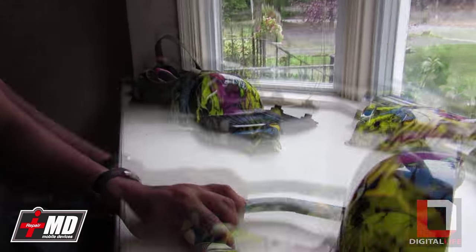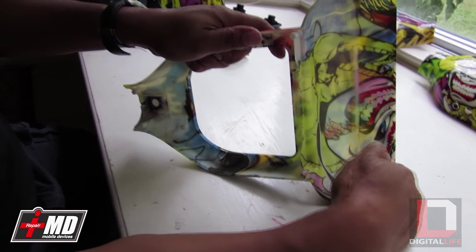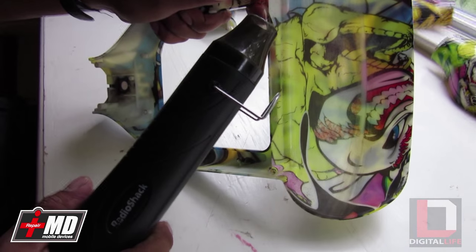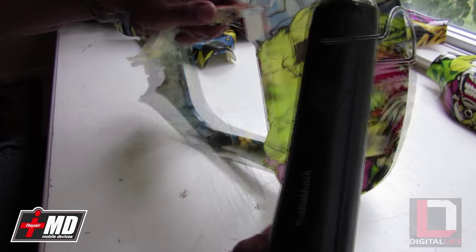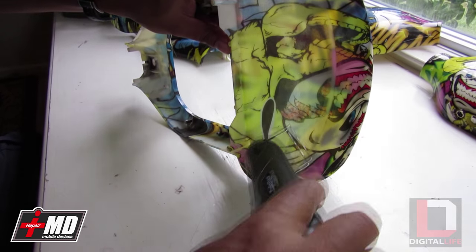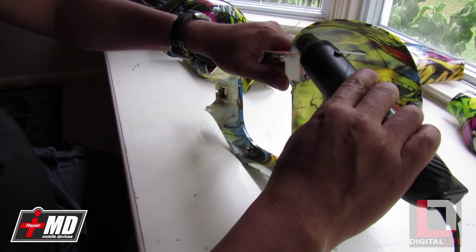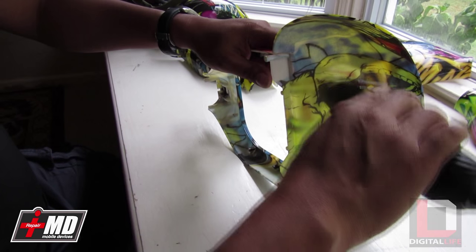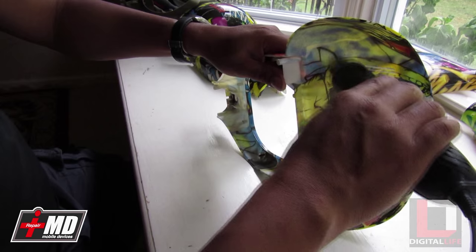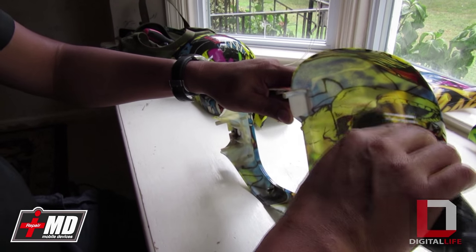This shell right here — the sound we were hearing when riding it was the pneumatic tires skidding on here. You can see the bottom of the shell — the surface of the tires is rubbing against here, causing that sound. The owner wants us to fix it. The best way is to use a heat gun — we're going to concentrate on adding heat in this area right here, weakening and loosening the molecules of this plastic, and allow us to actually push it back a little higher. We're going to start doing that — move the gun back and forth in this pattern.